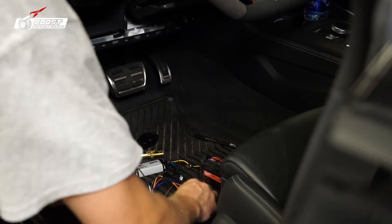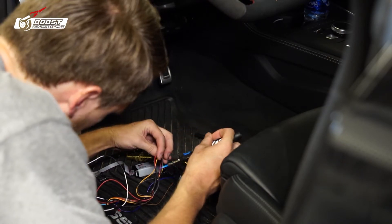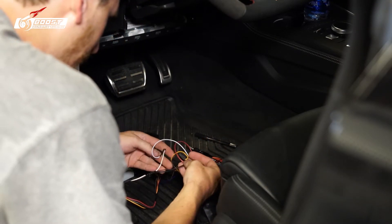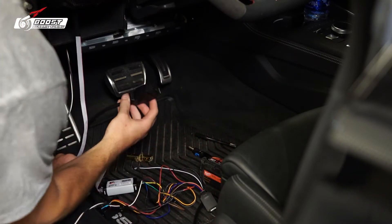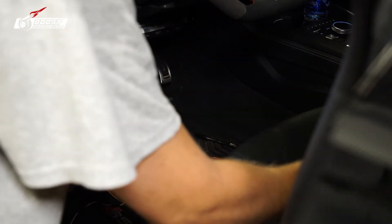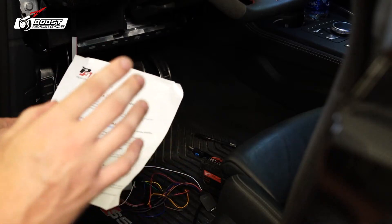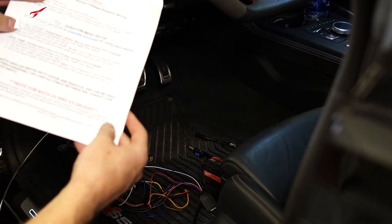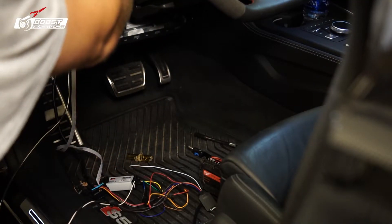It's time to shrink wrap everything. Now it's time to plug the sensor back in. Before I go crazy with it, plug in the OBD2 — got power and ground. The car has to be started here. For ethanol content, analog input brown wire on main harness — that's what we're doing. Hold both buttons on the gauge until you see CNF, tap to the right until you see A1N, tap the left button until you see CNF, then hold the right button until the screen goes blank — this saves and exits to the menu.